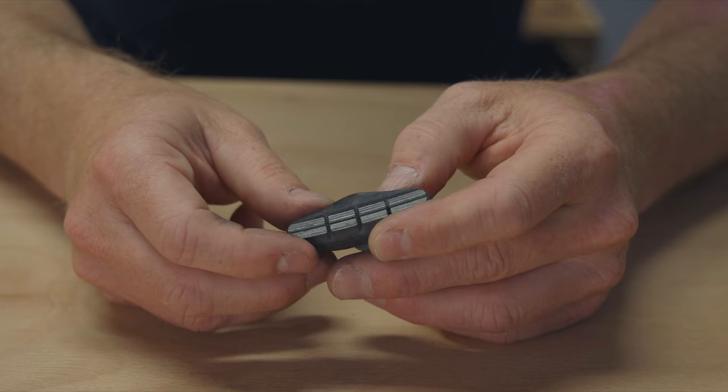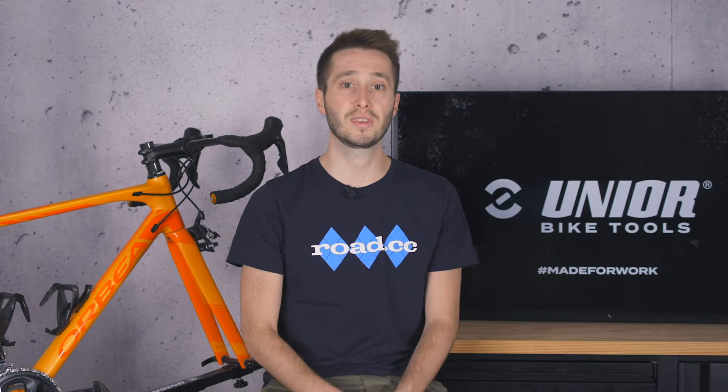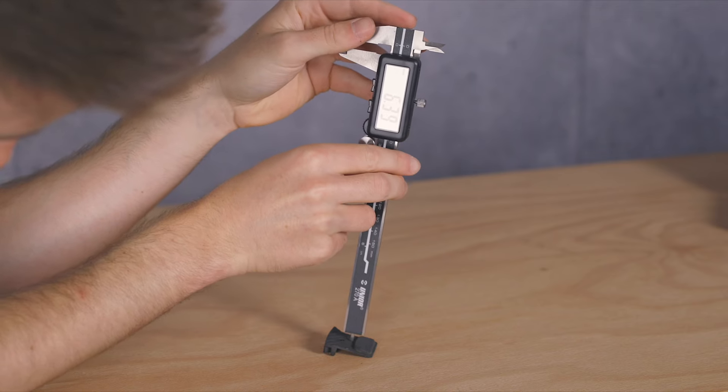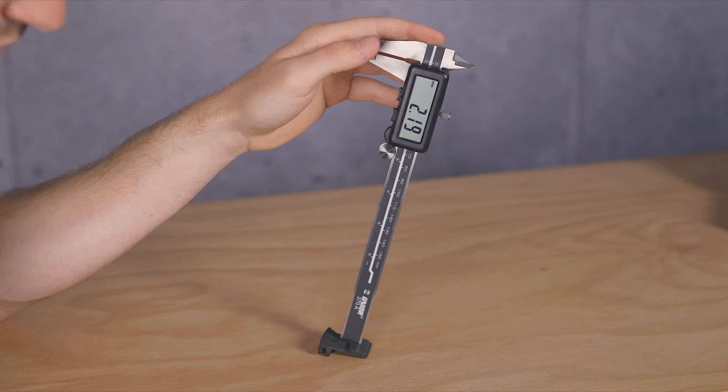And finally, check for glazing. This is caused by constant heat cycles which can't be avoided, so it's completely normal. Take a file or some sandpaper and take the glaze layer off. For disc pads, you're really just looking to see that there is enough pad left — you really don't want to get down to bare metal. That will sound horrendous and it will be very dangerous too. The rough rule is any pad under 1mm thick needs to be replaced. Digital verniers or a simple tape measure will do the job. You can take the glazing off the pad using sandpaper or a file — just be careful to keep the pad surface flat.